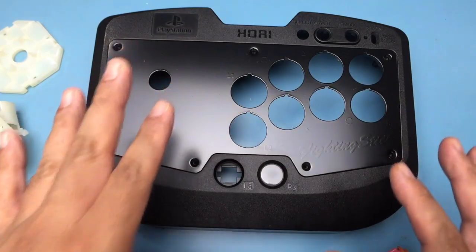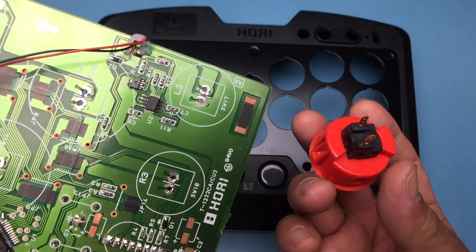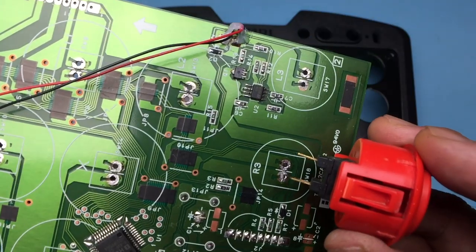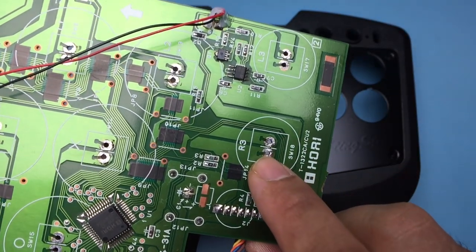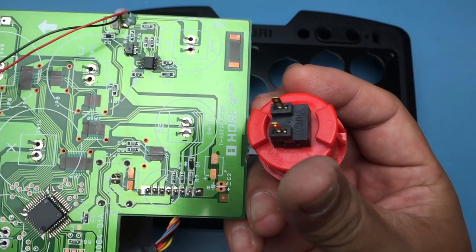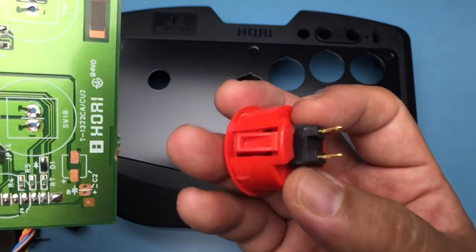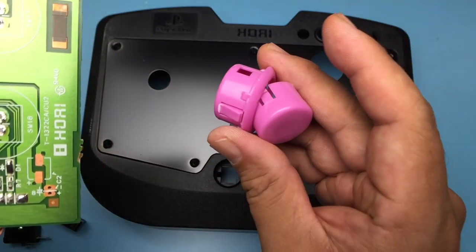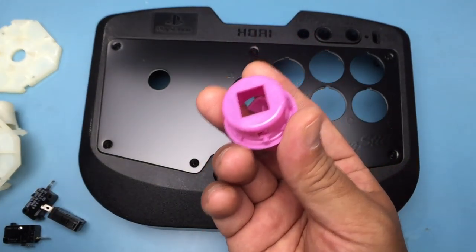on the bottom plate. Now, if you do want to use this PCB mounted to these, you probably could if you bent the connectors here so it'll line up on the board, and you would have to file these down to make the holes wider to accommodate arcade switches here. Again, these switches can fit into the stock buttons here if you wish to use the stock buttons.